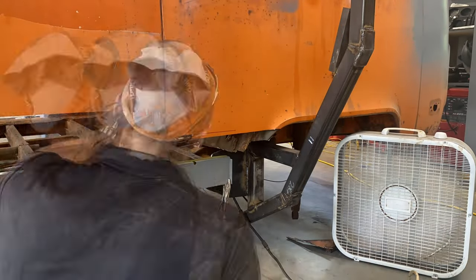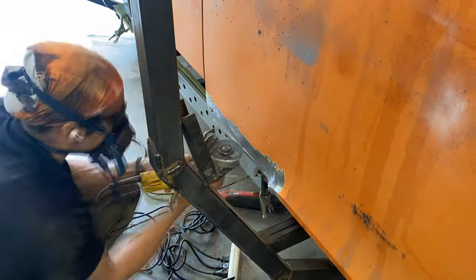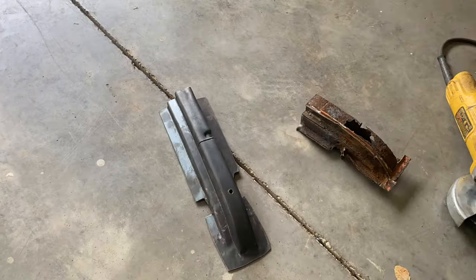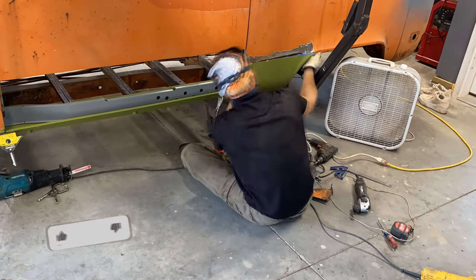The time has now come to install a custom-made C-pillar. So, I made sure that I cleaned up the areas where the skin for the front of the fender was gonna go, so that I could use the skin itself to give me the template for where the C-pillar went. I then used the old C-pillar, put them side by side, and tried to transfer measurements, but it's not very easy when you've got a curved surface, and I'm not very good at measuring things.